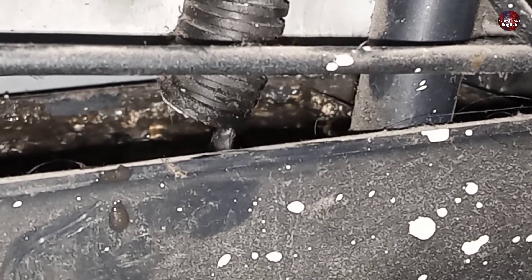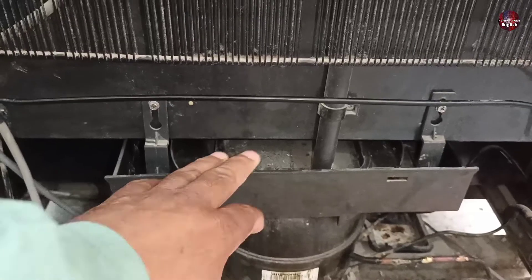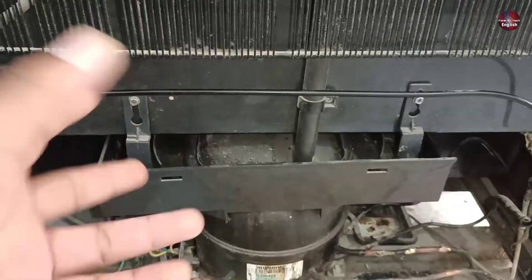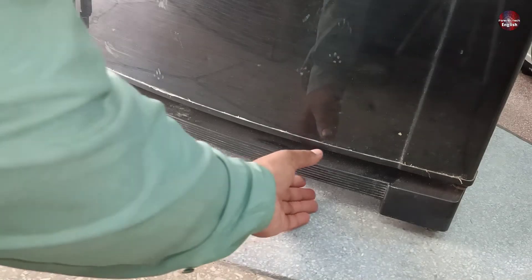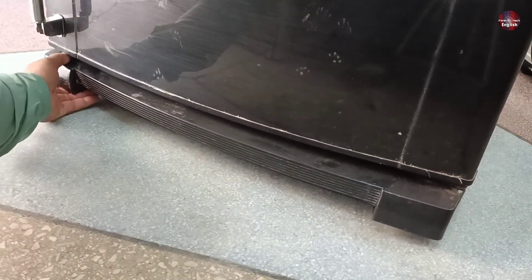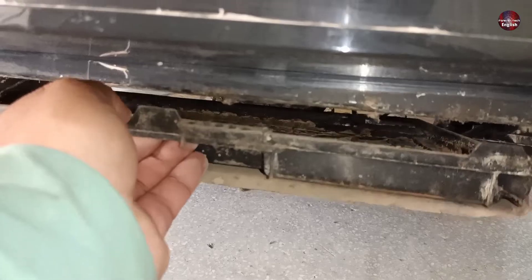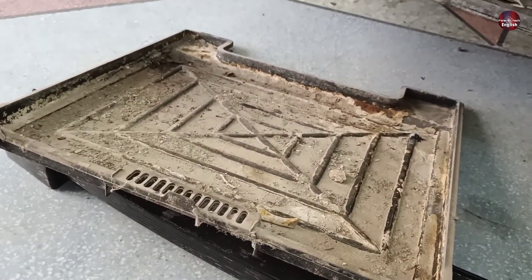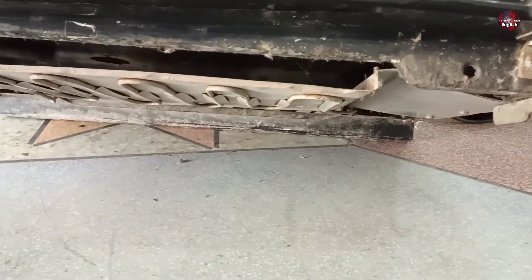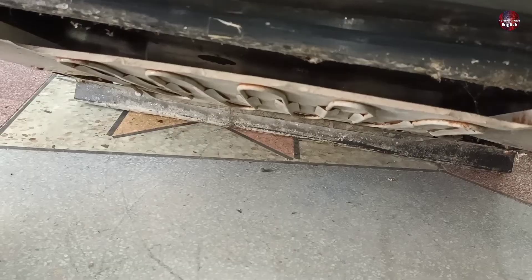If your refrigerator is flowing more water into the drip tray and it accumulates, then you will have to clean it. To clean the drip tray, open these screws and remove the tray, then install it back with the same method. You can also remove the tray installed on the front of the refrigerator for cleaning, as companies make different refrigerators. Now I will pull the cover and remove the tray. See how dirty it has been but dry. If I pour water, the tray will start to stink. For vaporizing the water, you can see these pipe coils are installed here. This pipe gets hot, warms the tray, and vaporizes the water.